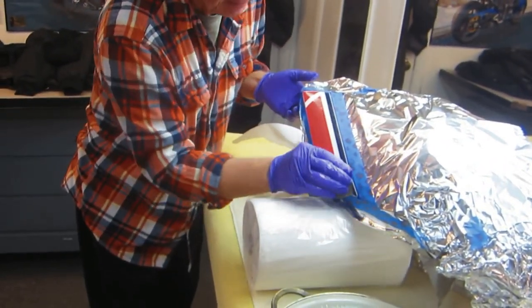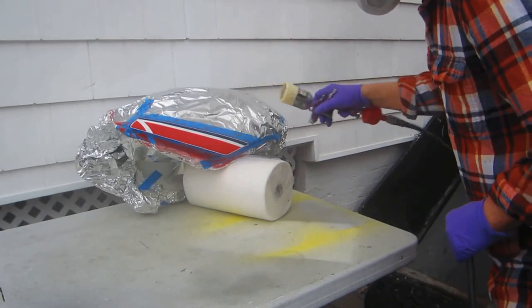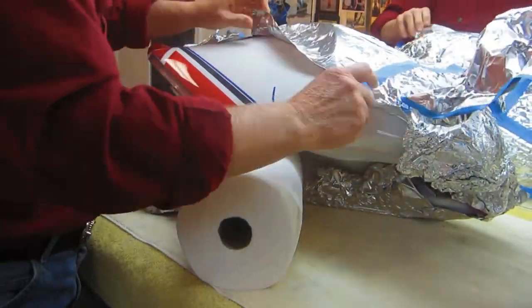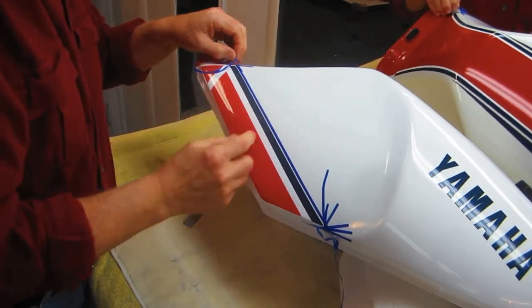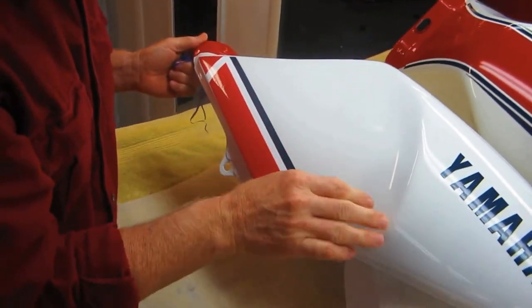If we weren't able to do that — or if you were willing to live with that edge, and I'm not, and I know Dale isn't either. Dale is very critical of his collector bikes, just like I am, and we wanted this one to be perfect. Got the extreme clear right up over the edge. This part of the job requires a lot of patience. Using a heat hairdryer or heat gun, carefully warm up the tape. The paint we've just put on is only a couple of days old and it's soft. I don't want any residue from the aluminum foil on there, and I don't know if this tank has ever been repainted. The best way to ensure the tape comes off without any problem: get everything nice and warm. Warm tape comes up a lot better than ice cold tape — tape gets stickier and stickier as it gets cold.